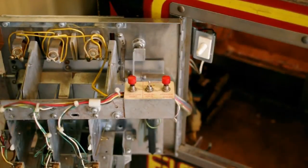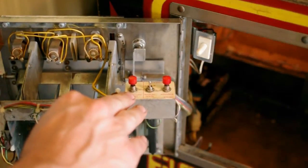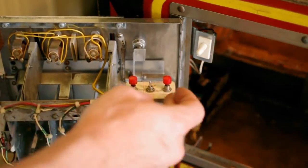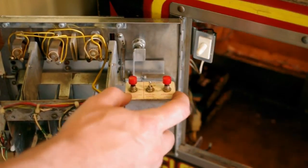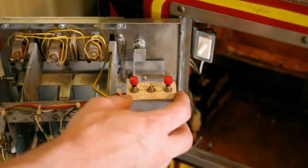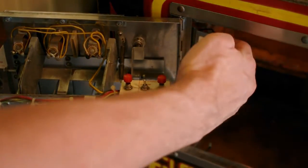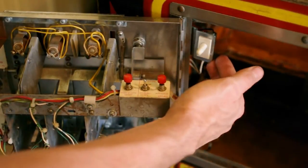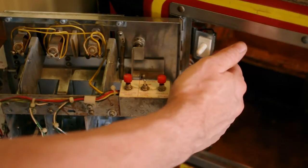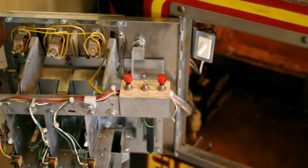There are a few switches inside your coin door that I'm going to be referring to pretty constantly. These are your main diagnostic switches in a System 6 machine: you have your high score reset, your auto up / manual down switch, and your advance button. These are all going to be present on a System 4 machine as well. System 3s will be a little different — we'll cover that in a future episode. Lastly, you also have your memory protect switch on the coin door, which is not present on System 4 era hardware but is present on System 6 and everything afterwards. We'll cover both System 4 and System 6 in this all-in-one sequence.